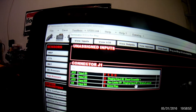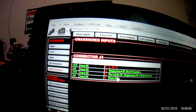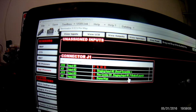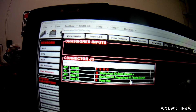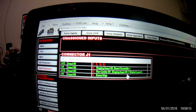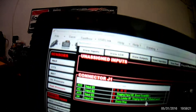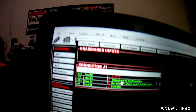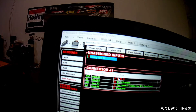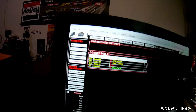Not quite sure if it'll work, but from what I understand it will. On input three I have my rev limiter one, which is my two-step, and staging input number one. All of these options show up in the box up here, and literally what you do is grab it and drop it down on whatever input line you want.